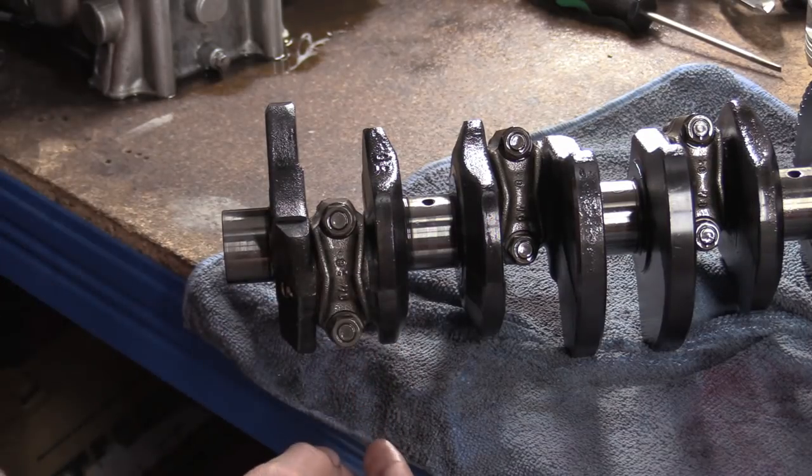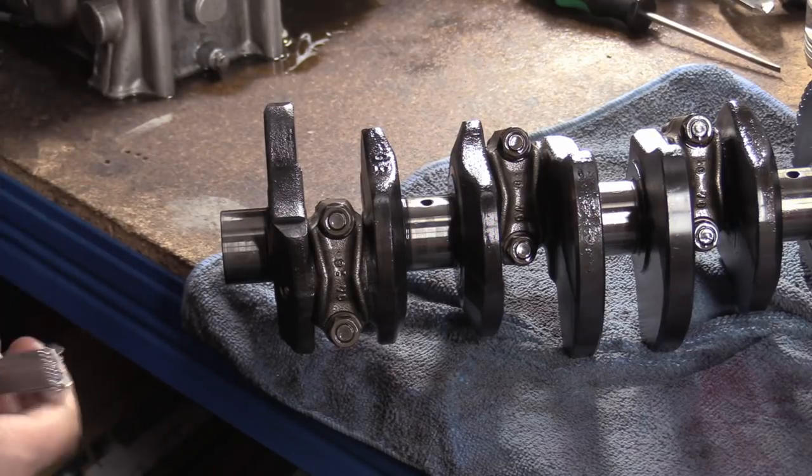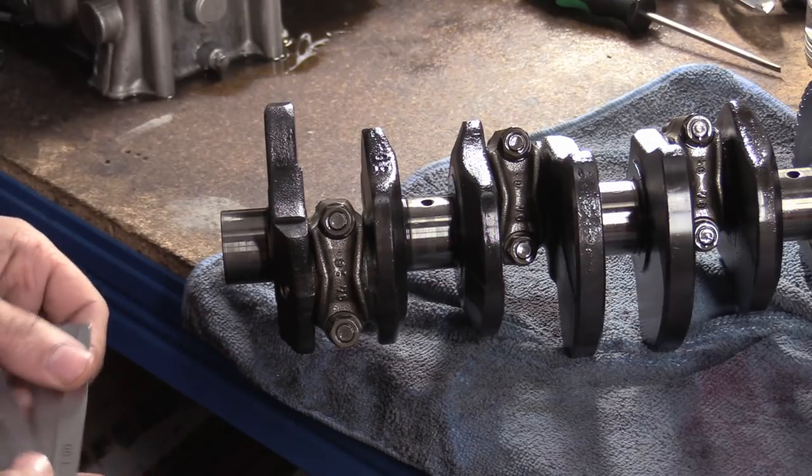The limit here is 36 microns to 66 microns — holy shit — and the service limit is 100 microns. So the first thing I do straight away is get out your 100 micron blade.